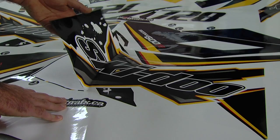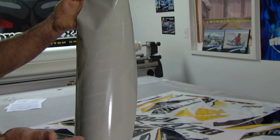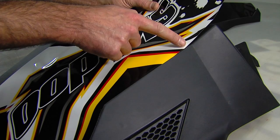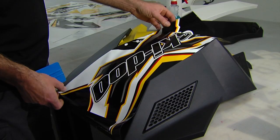This stuff has a laminate on it — it's fairly thick so you don't want to pull and stretch it, but you can literally pull this off in one piece. Now the one thing you don't want to do is let this fold in and touch itself. It's not impossible to get it apart if that happens, but just be careful. All the pieces are manageable. This is the biggest piece you will get in your kit. I'm going to use this point right here as my reference — I'm just going to touch that with my thumb and I want this line to follow the top, that exact edge there. If you get that there, everything else will fall in place and it'll all fit perfectly.